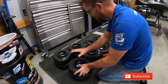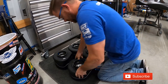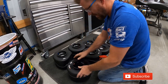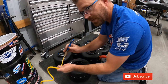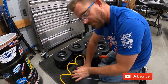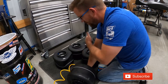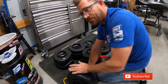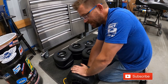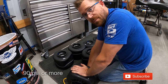The reason I have all of these lined up upside down is so I can quickly spray each bead, push it in, flip it over, and spray the other side. Now it's the correct side up so I can get to the valve stem. I leave the valve in there and just use a good quality air chuck like this one from Motion Pro — you can get these on my website as well. I'm going to go ahead and bead this and continue on. My air compressor has a line pressure of 120 pounds — make sure you have a decent air compressor to keep up.